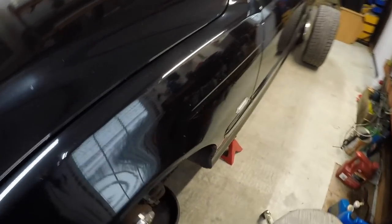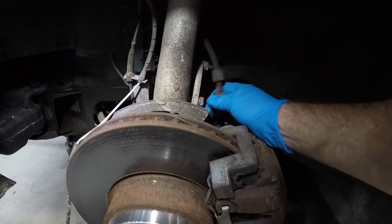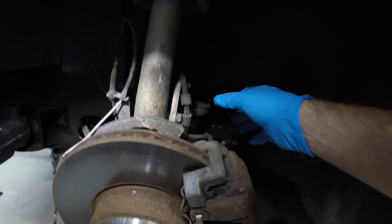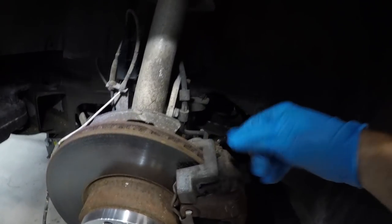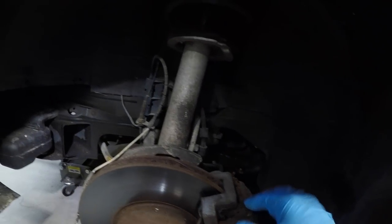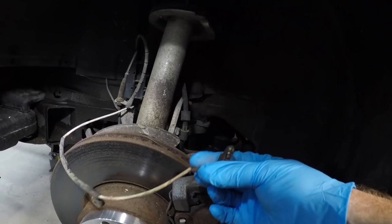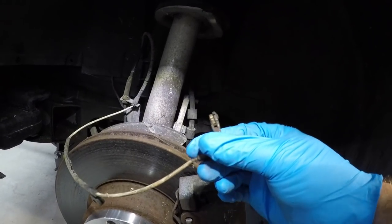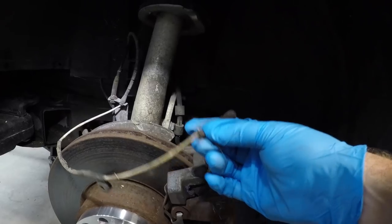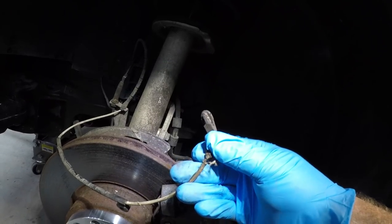So I found a few things wrong with the old brakes. For one thing, somebody had this caliper off at some point — this hose is all twisted up. When I take it off I need to make sure to twist it so it's not all bound up and pressing against the spindle. The next thing is the brake pad sensor — it's just kind of sitting in there, it looks new, but the wires are a little bit frayed and touching together.